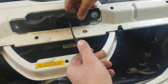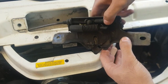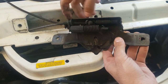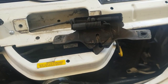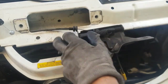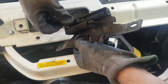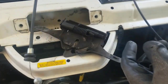There's a ball end that's basically hooked onto the actual mechanism, and that little rubber grommet just seats it in place. The new one also has a ball end and rubber grommet. Get yourself a good flat head screwdriver — you're able to remove the grommet section first, then unhook the ball end. I found the best approach is to lever the rubber grommet upward, then slide the cable mechanism forwards and unhook the second metal wire from the little catch. That's the old one out of the way.